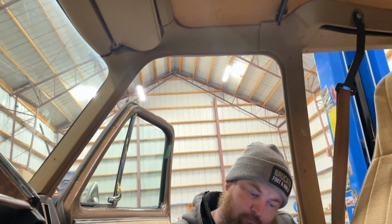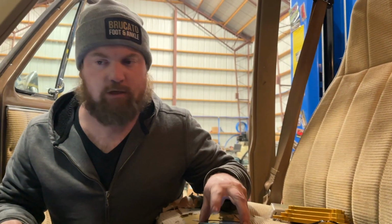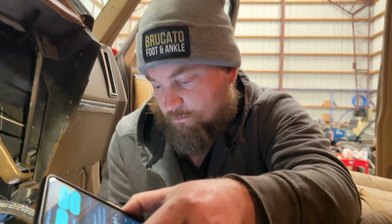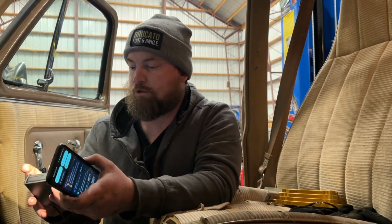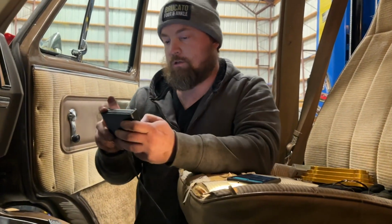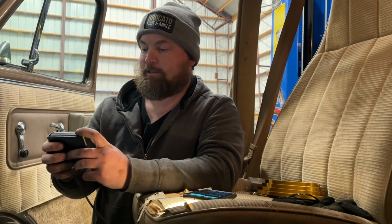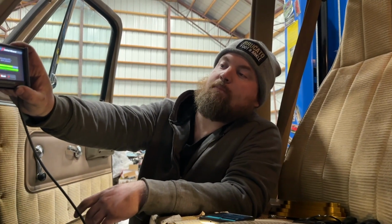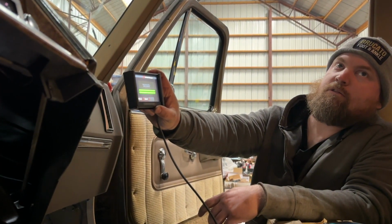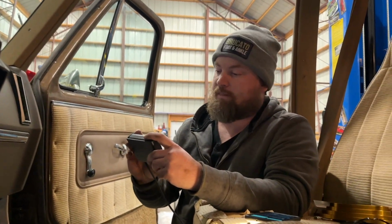2531768. Boom. Got him. I'm just going to tell it that we're using a factory sensor for now. I'm just going to say it's a GM one bar. Drive-by-wire. Yes. Transmission control. Yes. Transmission 4L80. Tire diameter 31. Rear end ratio, don't really know that. We're assuming it's like a 293 or something. That just affects the shift points. So now it's loading up. It's tuned. Oh, that was it working. Oh, you know what? Maybe I had to have this tune on it first before I could do that. That makes sense.